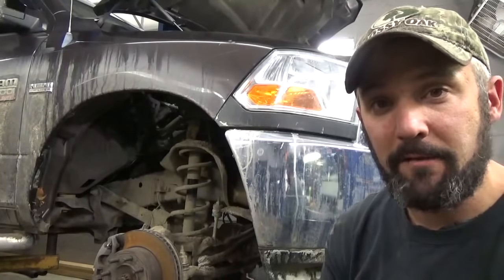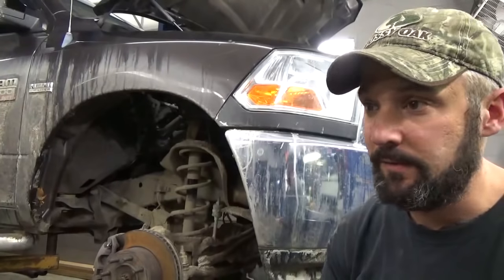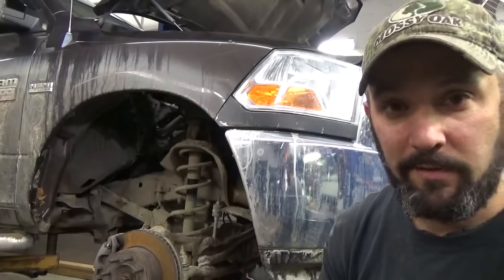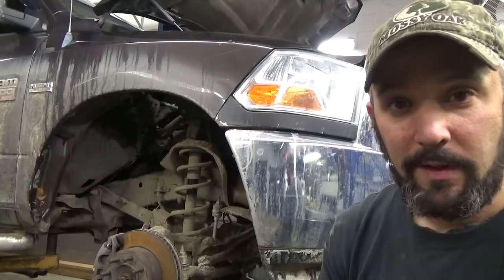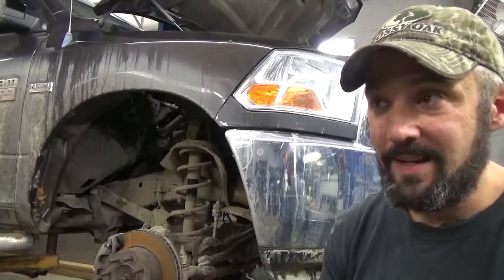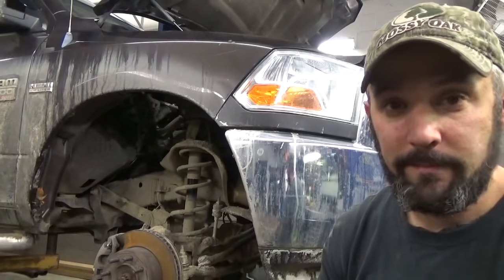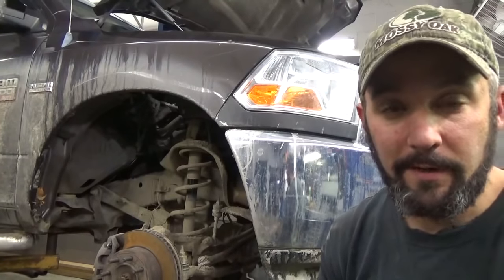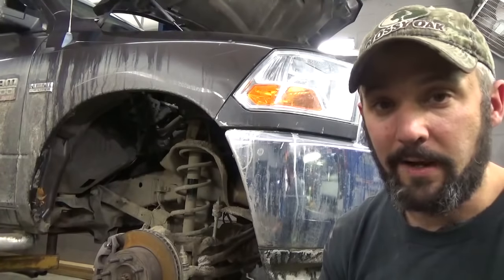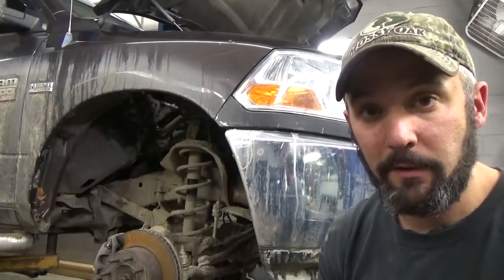I do a lot of exhaust manifolds here. I do a lot of them on the 6.0 Chevys and the 5.3s and Dodge Dakotas and Hemis and 4.7s, and I don't know, they're endless. At any rate, this is the method I usually employ, and 95% of the time it works. So the other 5% of the time you end up going in with a 90 degree air drill, center punching it, drilling it out, trying an extractor, and if that doesn't work, we just finish drilling out the rest of the way and put in a helicoil if we have to.